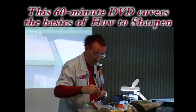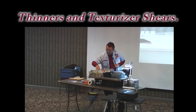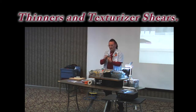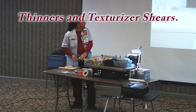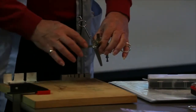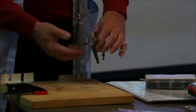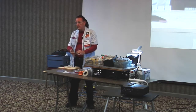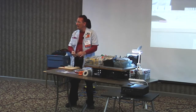I'm going to start with the fixed blade on this. How many of you noticed that this fixed blade on this supercut is pretty well nicked down into this solid metal here? To get this to work, you're going to have to take all that nick out. The same thing applies for a 4420 — it's flat on the inside. If you don't want hair to get pinched between the teeth and the fixed blade, you've got to take all that nick out.